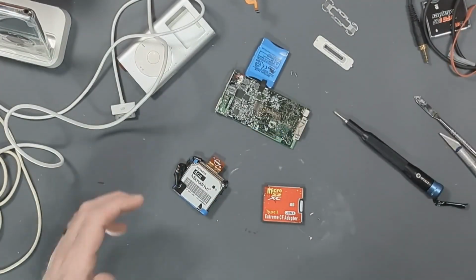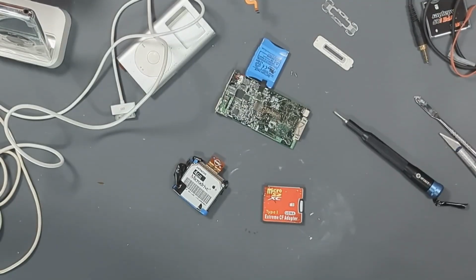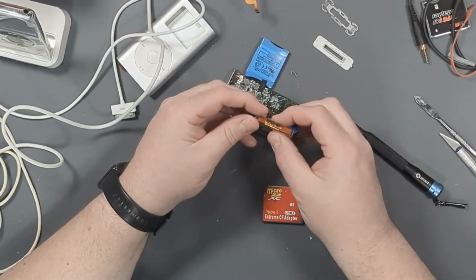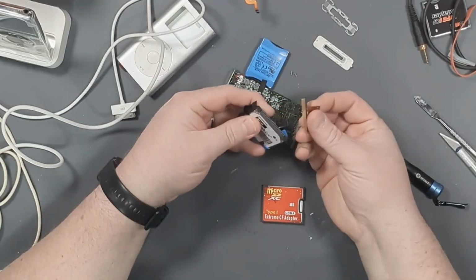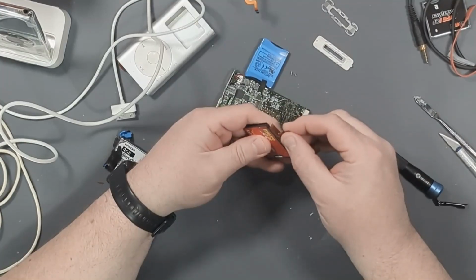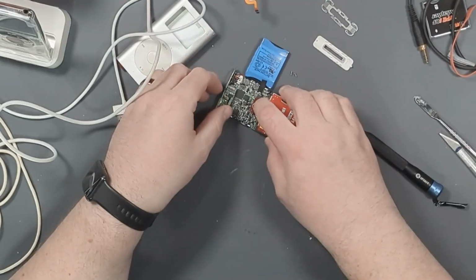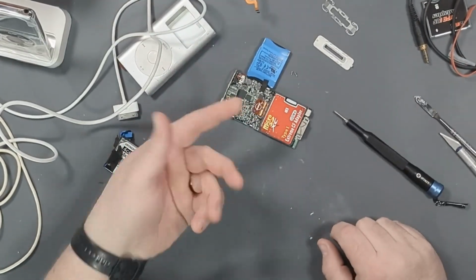Okay, so apparently I haven't been using my microphone this entire time, but fixed it. Guess better late than never. So after a little bit more disassembly, yeah, it's just a compact flash micro drive that is in an iPod Mini 2nd Gen. So I'm just going to take the adapter pins out of it and connect it up to the CF adapter that I was going to use in the other iPod. So I'm just going to go ahead and connect it back on. So it just clicks right back in there, and that's it.